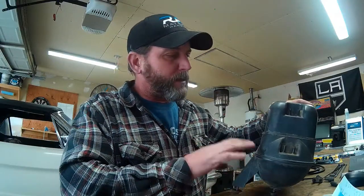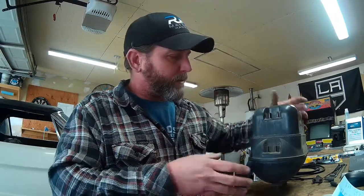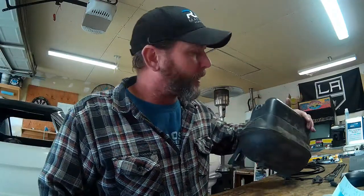On my truck I'm going to use a vacuum reservoir I have kicking around — it's actually off my old '94 gasser. It's a double-stage reservoir: a nice large chamber at the bottom for your main vacuum-driven accessories, and a smaller upper chamber. I've got plenty of room on the passenger side fender well inside the engine compartment, so I'm going to drill three holes and mount this in there, then use the bottom part of the reservoir to provide vacuum for my climate controls.